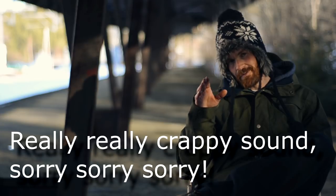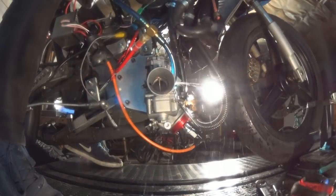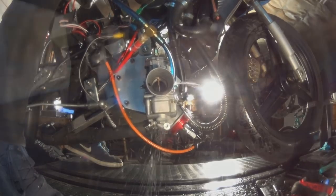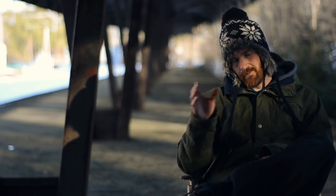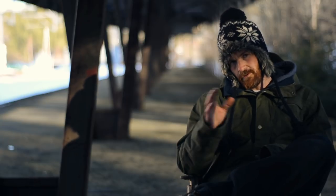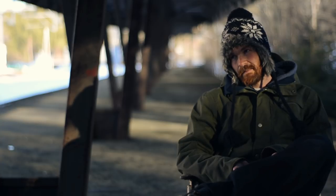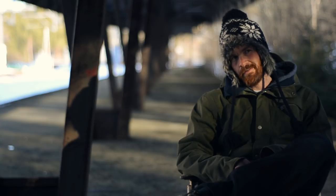But it's pretty obvious what is the main problem here. Fuel foaming. Severe fuel foaming. I've been here before, and the float bowl well I made could help. So could a softer intake. Of course, rebalancing the crank could help. A pumper carb or injection should solve the issue.